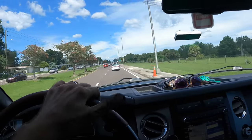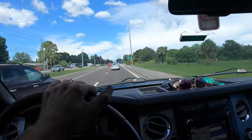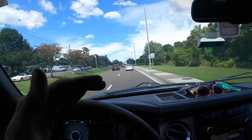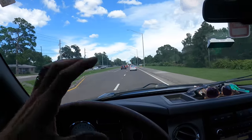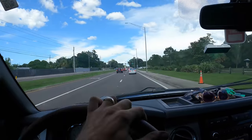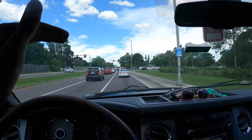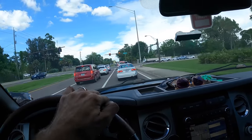They still have good tread on them, and truth be told, if they were mine, I wouldn't change them either. I would just deal with the noise until they were worn out. Now, I did rotate them to the back, and I cross-rotated them, so the choppy section of the tire, the way it was wearing that was causing the noise, has now been turned around the other way. So the leading edge on the chopped areas of the tire, those are going to wear off faster. And there's a chance it'll eliminate itself as that leading edge wears off. It may or may not, but it's at least worth a try. So I did that too.